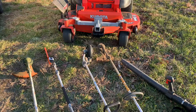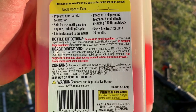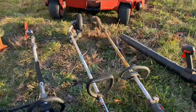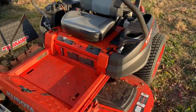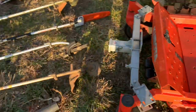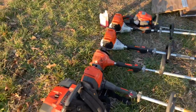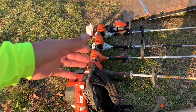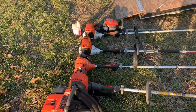If we flip it over on the back, the directions state to use one ounce — or 30 milliliters — per two and a half gallons of fuel. As I mentioned, I went ahead and put the Stabil in my mower. I know for a fact my mower has a five-gallon gas tank, so I put two ounces of Stabil into the tank. We got that running, got the grass cut, let the stabilizer do its job and work its way in. I topped off all the fuel tanks on all this equipment, and just looked up the specs of each machine to see how much fuel it holds so I could get the right ratio of Stabil.